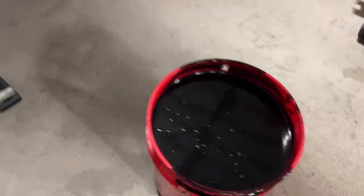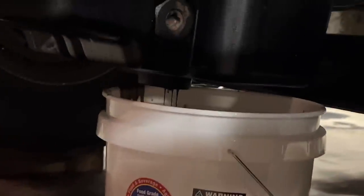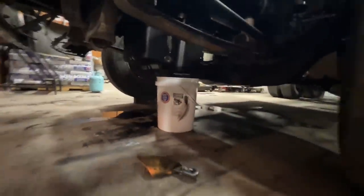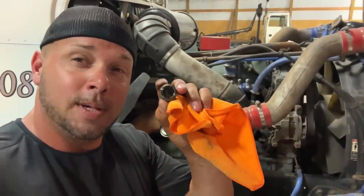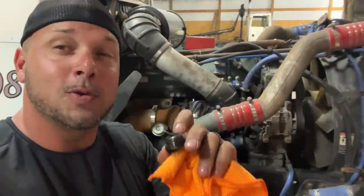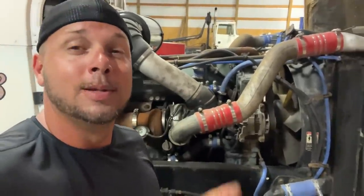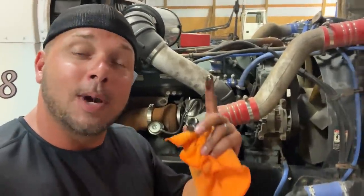So we have gotten our black gold out. Seems like Detroits always turn the oil straight black, they say. You're going to need to get it up on a little bit of wood to get under the lower drain plug — there's a drain plug on the side. If you want the bottom one to get all that out, you need that clearance. We've got that clearance, wait for it to drip out, then we'll start getting these bolts down on the pan. And one more thing: the drain plug has zero metal on it. It had a little bit on there when we first did the oil change. We've ran it a couple of times, probably put 50 miles on it, let it idle for a long time — it would have had metal on there if something catastrophic was coming apart. So that is a good sign.